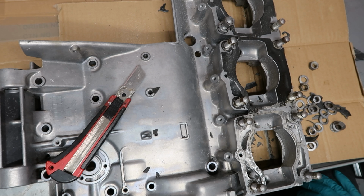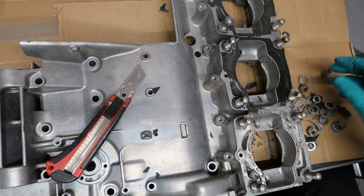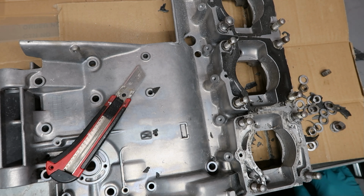So that was one. And the other thing as well, you have to be really careful that the tightening torque is specified for the use of whatever lubricant you use. Most torques are quoted for either dry, or if nothing's quoted, they're quoted for what's called light oil. So basically, I don't mean squirting it with oil, but they're not bone dry. There's something on them, right? If you put anything on them, you substantially have to reduce the tightening torque massively, right?